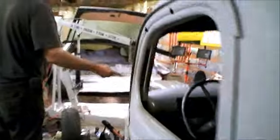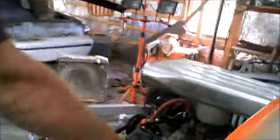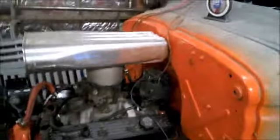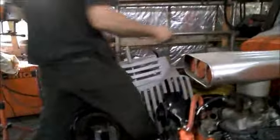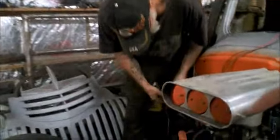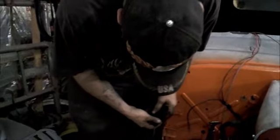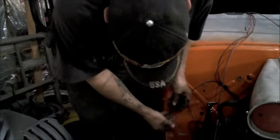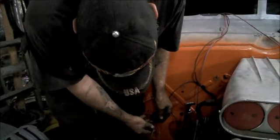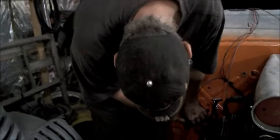I've got this whole setup here that I got out of a Chevy truck, and it's got all the connectors over here, so I've got my four wires. Basically, there's all my wires for my ignition. It's going to be put through the firewall. One of them goes to the starter — power, hot. And when I hook up my battery, I'll run a hot wire to this.